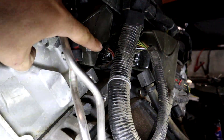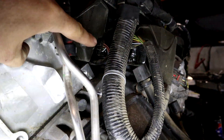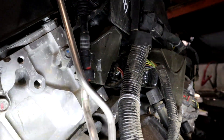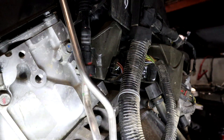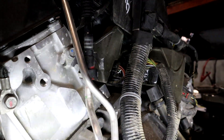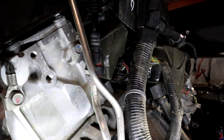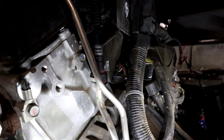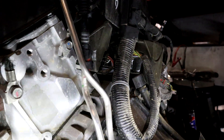If this sensor — or I should say the sensor connector — has three wires, you have a 2017 or newer. This is all the information I require when I get a build request on a harness. I need to know what that sensor is 100%, that way I can match everything up. If not, this thing will never fire.